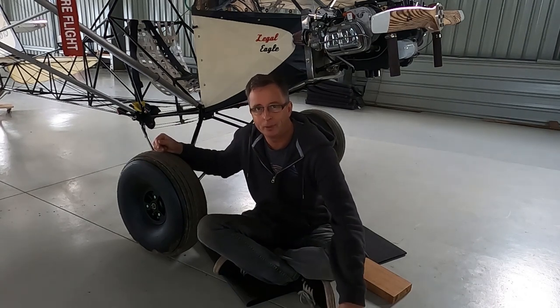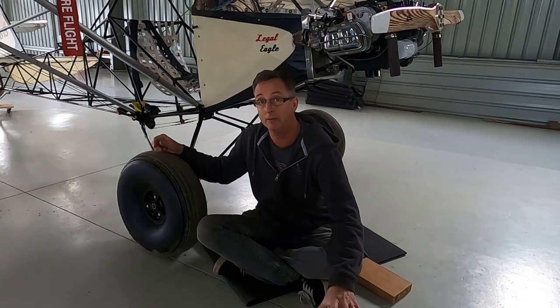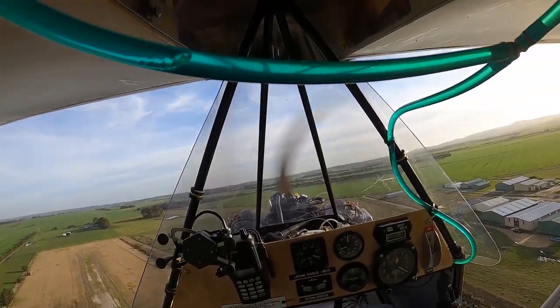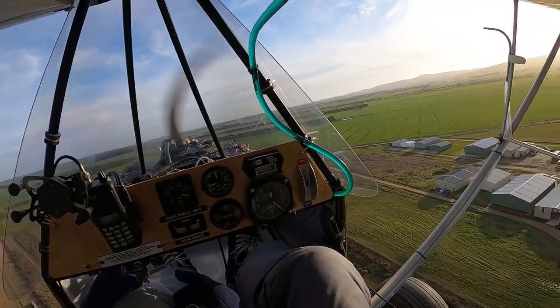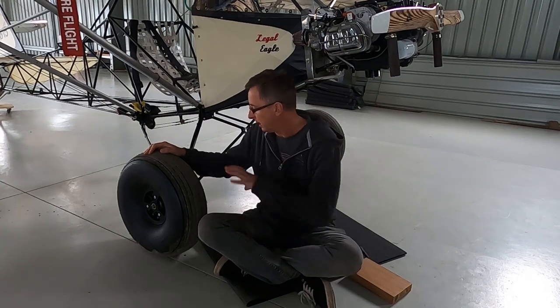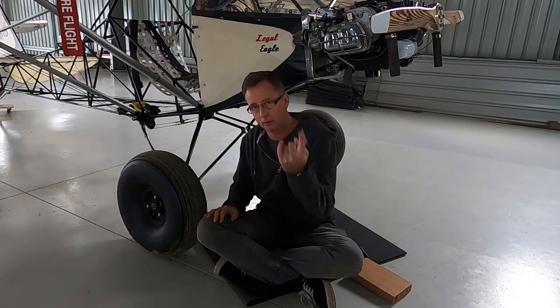I've been so happy with the spacers in hardwood timber that right now I'm leaving them — I'm not going to mess with it at all. They tracked nicely, the wheels were rotating quite freely in flight, and there was no shimmy to speak of. Occasionally you'd feel vibration because they just wanted to keep spinning in flight, so I pulled the brakes on and stopped — and any vibration stopped with that. In keeping with the black theme of the aircraft, I spray painted the spacers black as well. They fit quite nicely, all bolted up, and they really do look like a good part of the aircraft itself.